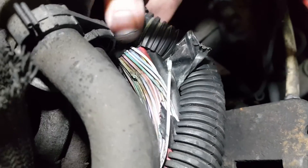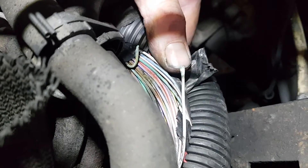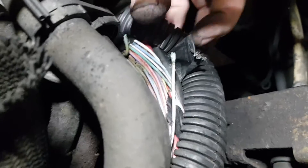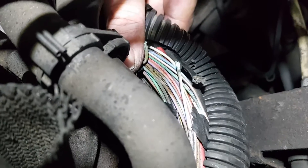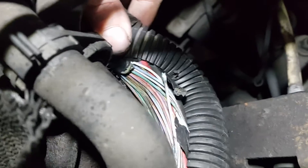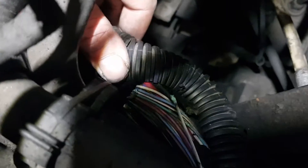I'm going to have a good look through here and see if any of these others have got any issues. We can get this re-taped and get something soldered in, and I'll do a re-check on it. Definitely our issue down here. It doesn't make you feel all warm and fuzzy inside when you work something out properly. As I say, if there's any other broken wires in there we can sort that out at the same time - which is why it's always good to find these things, as it's usually more than one. You might stop an issue in the future. I'll get this soldered up and we'll go from there.